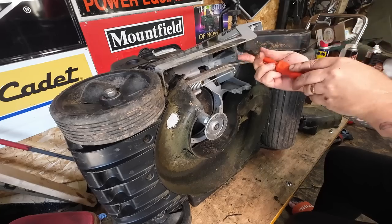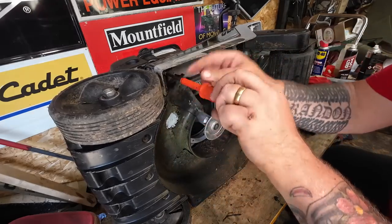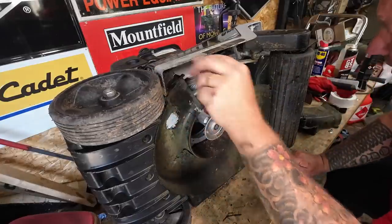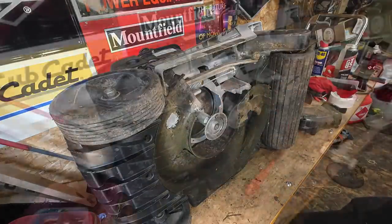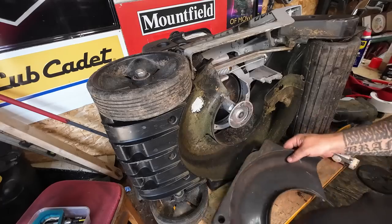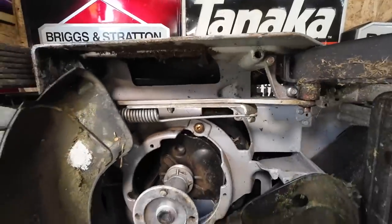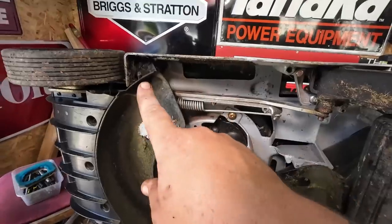Let me see if I can use the one off a donor machine to get this one up and running as it should. There's a bit of plastic that snapped off up inside here - I just drilled it out by about three or four mil so that this lug will go up into there and receive that. That one's all right, so we're good to go there. The little mower that my mate Pete Frow gave me - because he couldn't be bothered to fix it himself, he had no time - he said take that one away, you can have that.